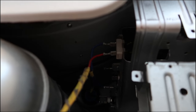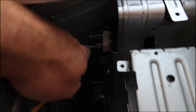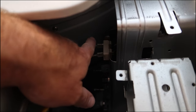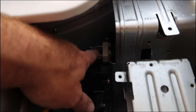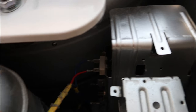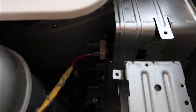Remember, we did unplug the power to this dryer, because these are bare connectors right here that could be electrified if plugged in. So obviously you want to make sure it's unplugged before you touch any bare wires or bare metal. We're gonna pull this assembly out, disconnect these two wires, and then we should be able to access the whole thing.